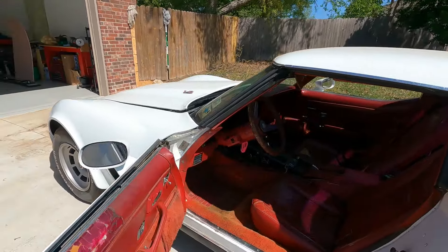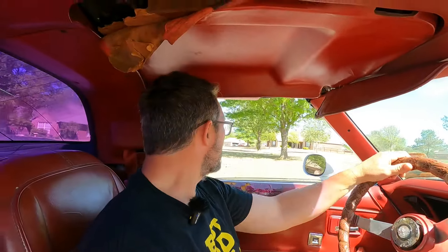Well, let's go take it for a spin. Here we go. The brakes are working — that's the main thing. A lot of smoke. The engine's been sitting for 20 years so internally there could be a lot of things that need either adjustment or replacement. Think valve seals, piston rings. It had good compression so I don't think the engine is completely worn out, but again everything rubber on this car so far has needed to be replaced.